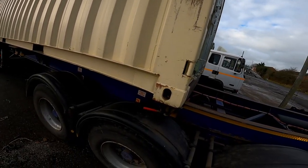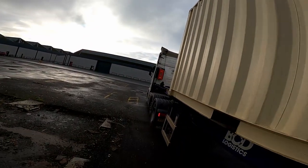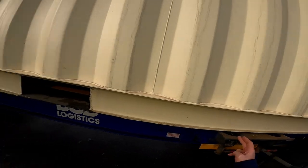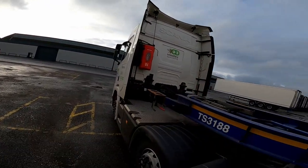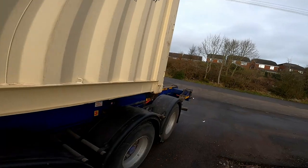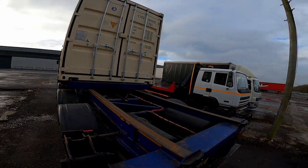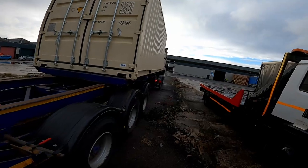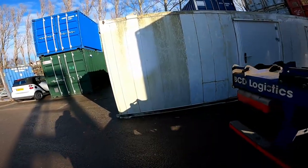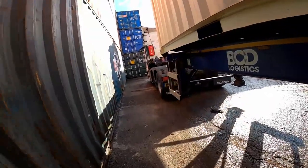20-foot containers on these trailers sit in the middle of the trailer — right here and right here. If you're going to have two 20-foot boxes, you put one here and lock it, and same goes in the back — they sit on these locks when they are open. Don't forget to do the twist locks before you lift off the box — very easy, four locks, just twist and that's it.